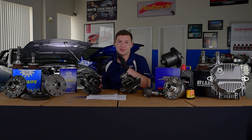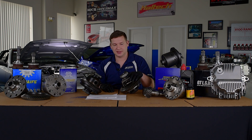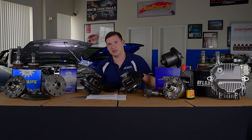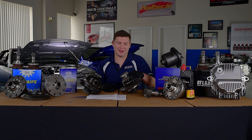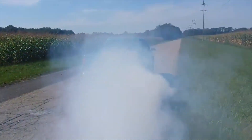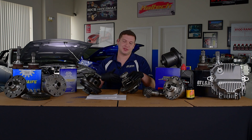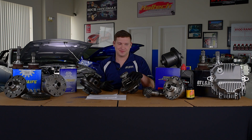There are quite a few flavors in the range. We're going to start with the saddest and work our way up on the characteristics. The R200 open diff here is what you'd find in most base model Z's or G's. It's the saddest of all diffs — notorious for the pogo, the yolo, the peg leg. One wheel peelers. Sad performers, unpredictable. They can send as much wheel speed to one wheel as the other — same with torque — which can really leave you disappointed and not performing well.